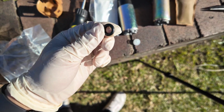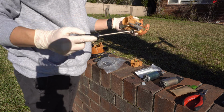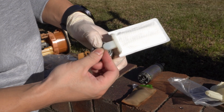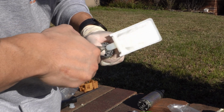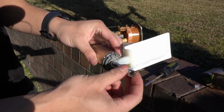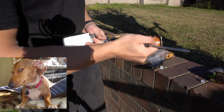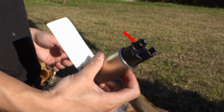This kit came with a new O-ring. I had no clue where it belonged, and I found that it lives inside here. I then installed the strainer, but man, I struggled installing this metal clip. I tried to pin it down with my pliers, but that didn't work, it just popped off. I found a quick YouTube video and they used a 5mm socket and just banged it in, literally. And that's it. That's your fuel pump done. From the old pump, there's this plastic clip. I took it out and put it on the new one, and put the O-ring on top of it.